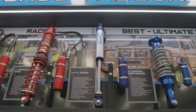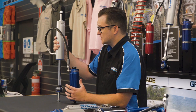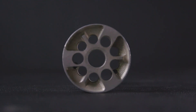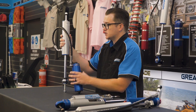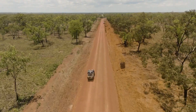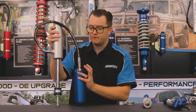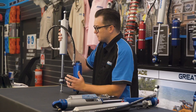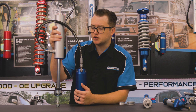From the 2.0s, we step up to the big boys — the 2.5s. These have a massive oil capacity with a two-and-a-half-inch internal diameter, and also offer a huge piston surface area. What that allows you to do is transfer more oil with less movement of the shock absorber, making it a much more comfortable ride. These shocks are designed specifically for vehicles carrying big loads and big GVMs when you plan on traveling long periods of time on rough surfaces. These also feature an eight-stage compression adjuster, but something we've added to the 2.5 is a 16-stage rebound adjuster, giving you a massive range of adjustment to fully tune these shocks to how you'd like them to ride and control those big heavy spring rates.